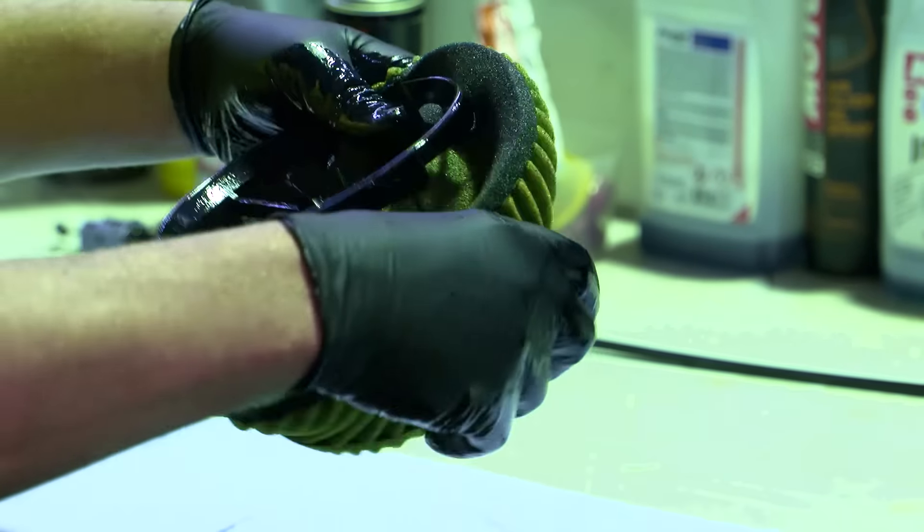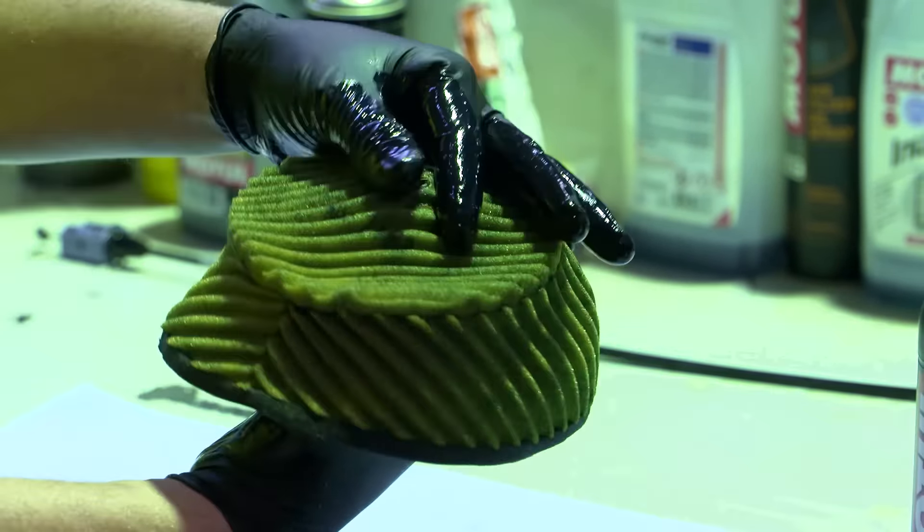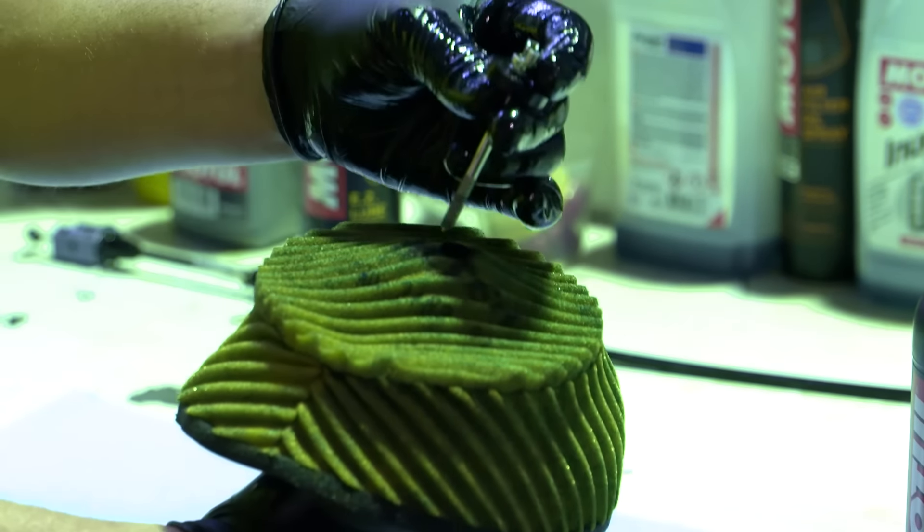Grab your cage, fit the filter back into the cage, slide it around, and flip it over. You just need to pop that little plastic piece back through the centre of the air filter to seal it, grab your air filter bolt, and pop it back into the bike.